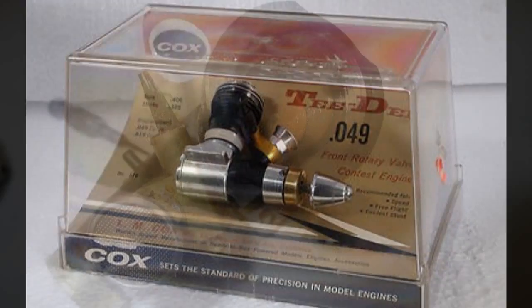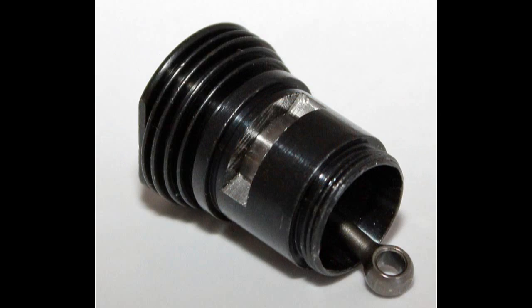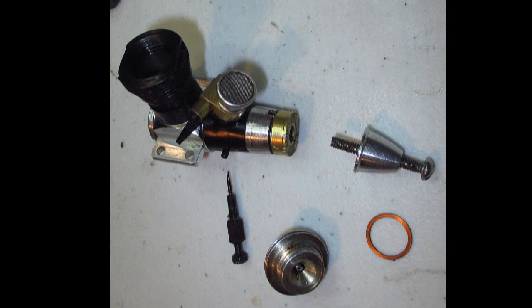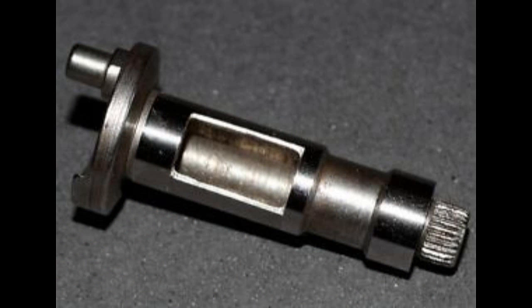The TD had a tapered and lightened piston resulting in a tighter piston fit at TDC — that's top dead center — and had a lot less piston mass. The cylinder has two deep bypass ports with bypass booster grooves, also known as side flutes on each bypass port, which resulted in a way better air-fuel mixture. The TD also has a true peripheral venturi for better fuel intake and draw or suction. It also has a precision, balanced, and milled crankshaft for better fuel intake and balance.